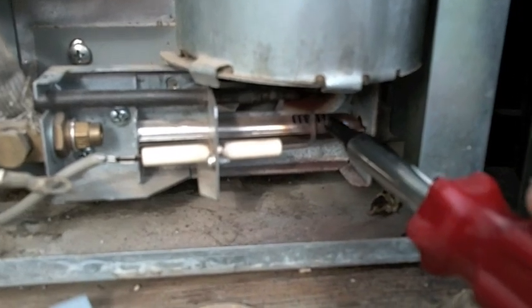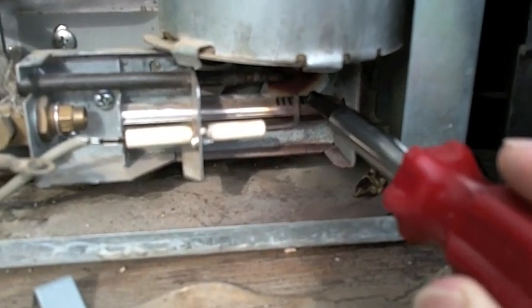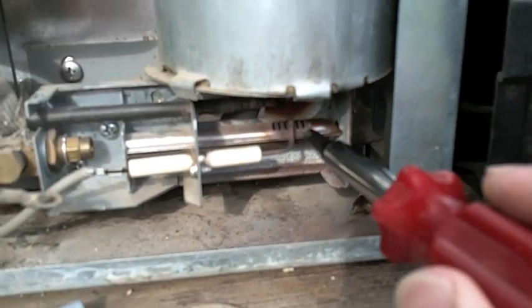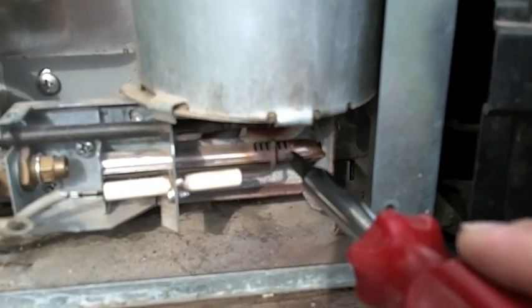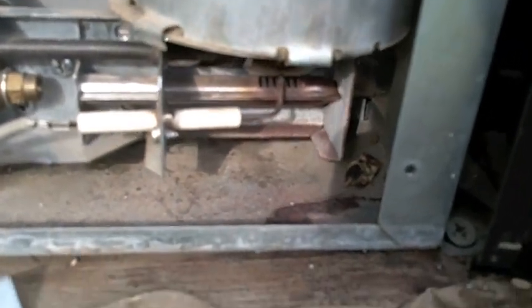This is your actual flame burner tube. It might not look like much, but if that thing is plugged or you have got a lot of rust coming down, it won't produce the right size and shape of flame. You can see the rust down inside here — look at these piles of it coming out. We've just driven this camper 2,500 miles, and it's old.